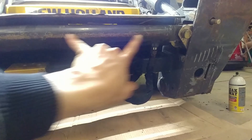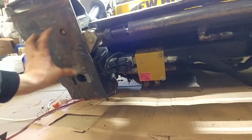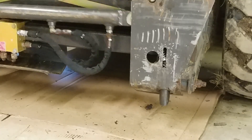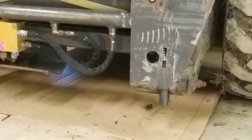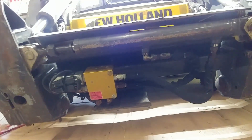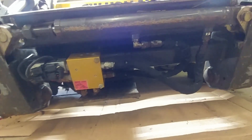Next you have this whole fancy system. These parts actually move when the cylinder pushes these locking triangular blocks out — they pivot around this point right here, and that's what changes the position of these pins down here. This area needs to be cleaned. If there's mud in there it's going to cause damage eventually, wear through the cable, do something terrible.